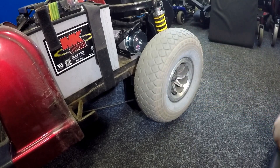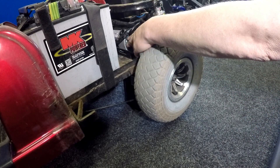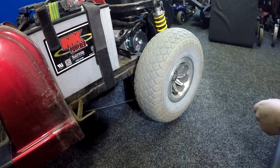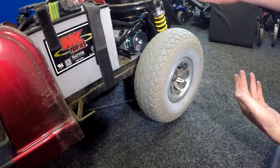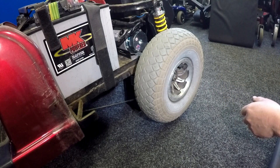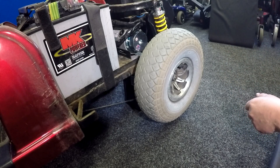And that's us — take it for a test drive. If it's not overheating and not juddering, it's going back to the customer. I'll advise them that whoever did the brushes has broken the dust cap on the motor. It doesn't necessarily mean the brake will fail straight away — it could fail after a specific amount of use. In this case it was five minutes, but I have seen some up to maybe half an hour or 45 minutes of driving before the scooter starts to judder and come to a halt. So bear that in mind.